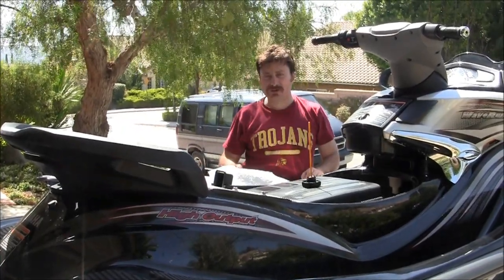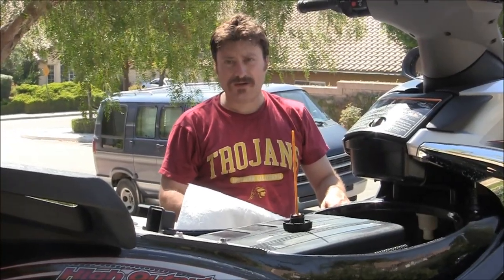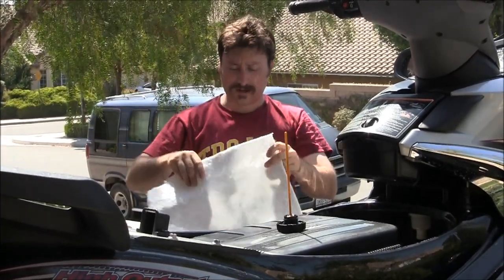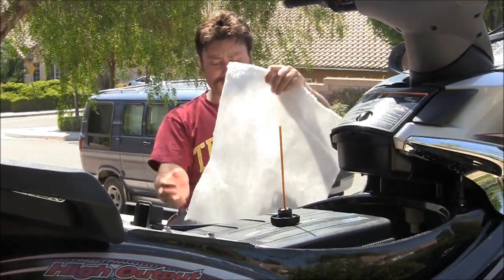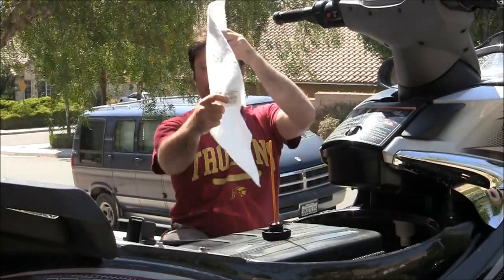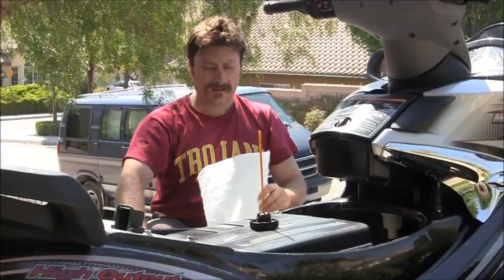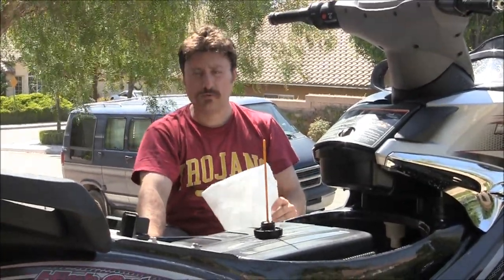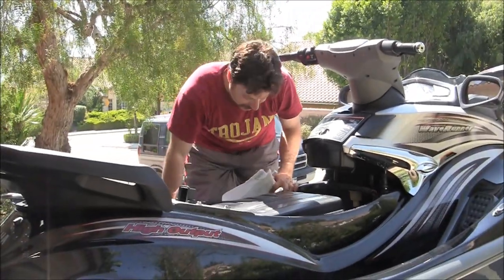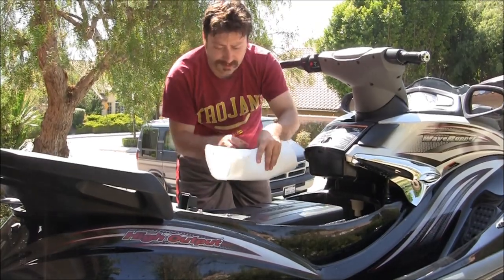So probably in some of the clips you will see me with a wetsuit — I was doing an oil change for my neighbor. There is this oil absorbent sheet that I want you to put — it's from 90% recycled material. West Marine sells these. Just put it underneath the pan, that way when you open the filter, most of the oil will be absorbed and it won't make a mess in your hull. I would basically try to roll it, get it in there, and unroll it.